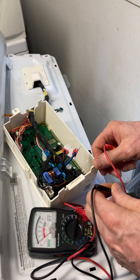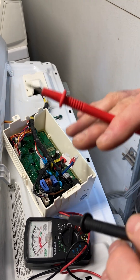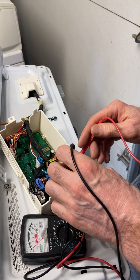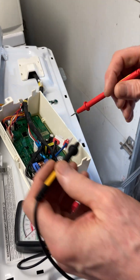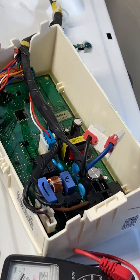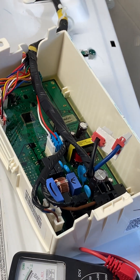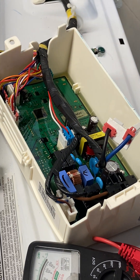This relay here is on, so I've got this on continuity and that's on in heating mode. The black goes to the black there — L1 or L2, whatever you want to call it — and blue goes to the other one.